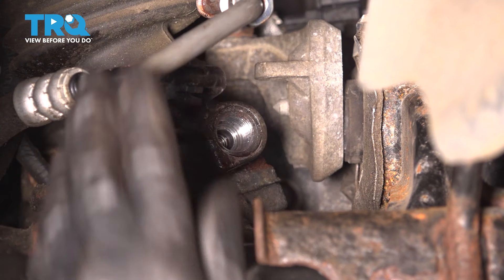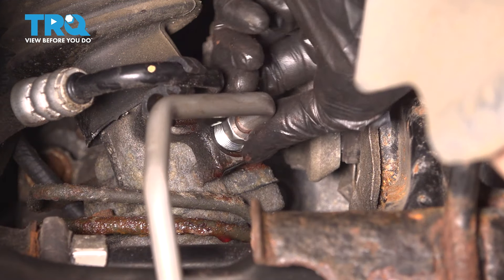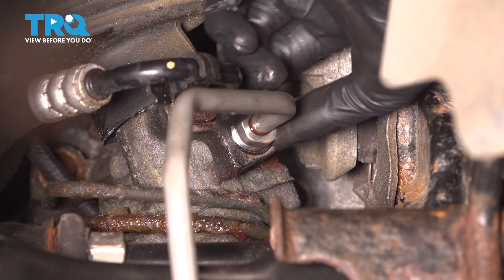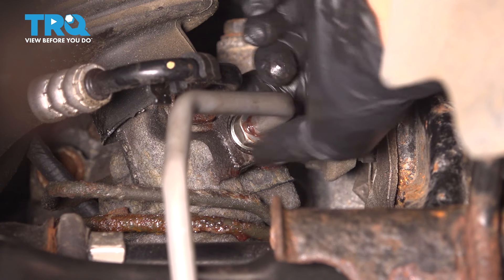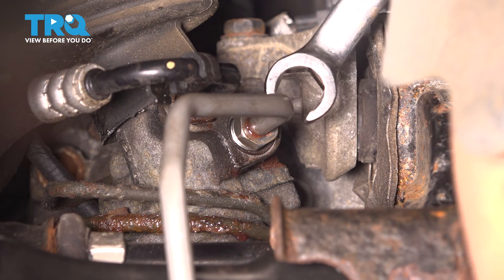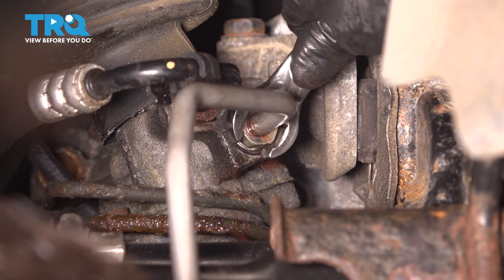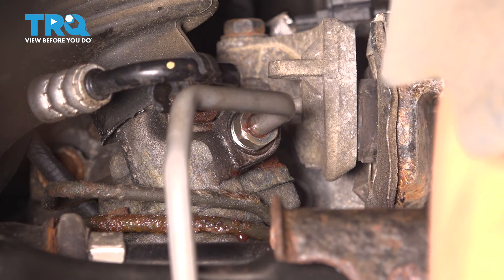On this end, make sure you put a new O-ring on this side as well. Start the fitting in — make sure it starts nice and smooth. This one isn't quite at the right angle. It takes a while usually to find the right angle, but once you do it should thread on smoothly. Now I'm just going to snug it up with my wrench.